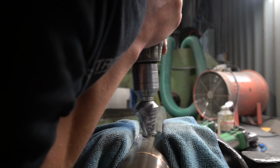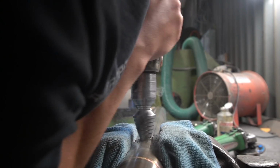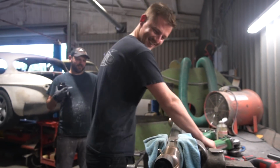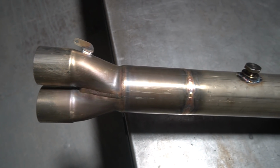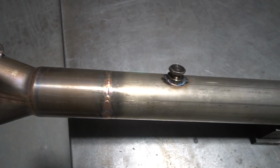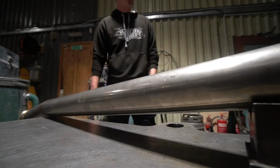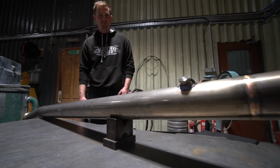We're not actually running closed loop on this. Some ECUs actually use a wideband or narrowband lambda sensor to feed a continuous air-fuel mixture ratio signal to the ECU, and can actually alter it on the fly. I mean, all OEM type internal combustion powered cars will tend to be like that these days. So it can actively tweak the mixture as you're going along, rather than just sticking to a set map.